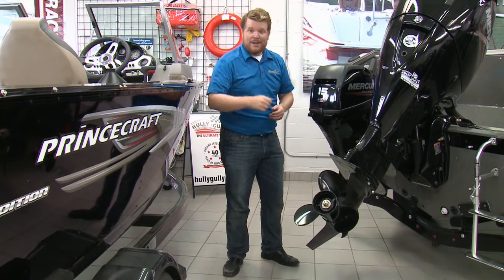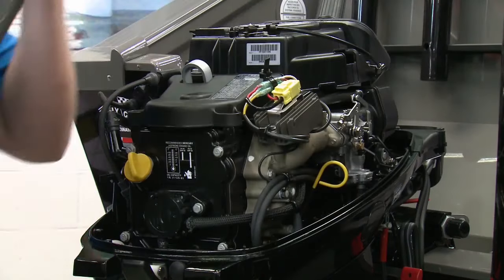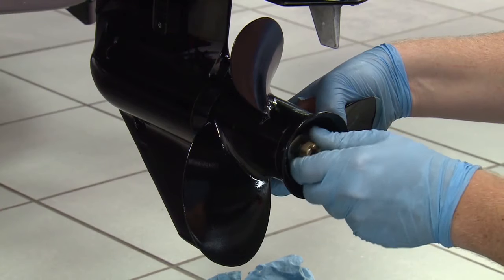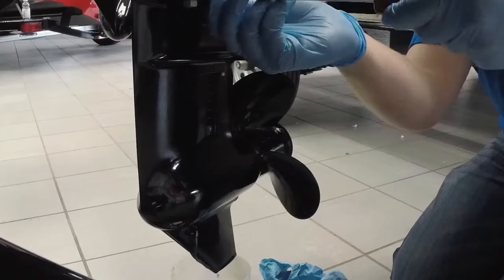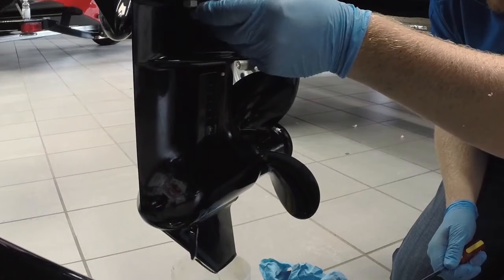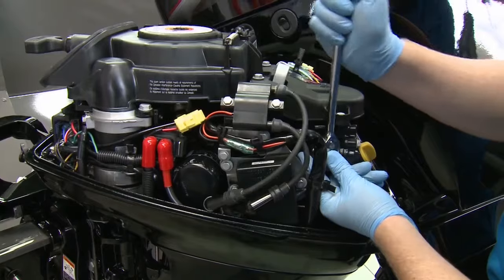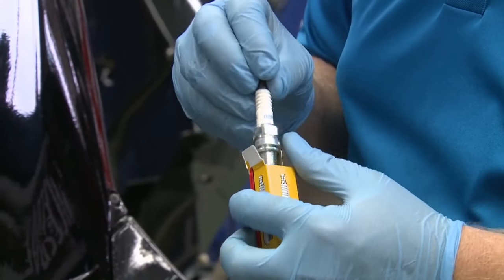It's a little more complicated, but nothing that you can't handle. The main differences are in the motor itself — this is also a 15-horsepower. Again, remove the prop and inspect for damage. The lower unit is virtually identical, though the location of drain and vents can vary based on model and manufacturer. The spark plugs too are virtually identical in terms of removal and replacement, though the exact model number is different.